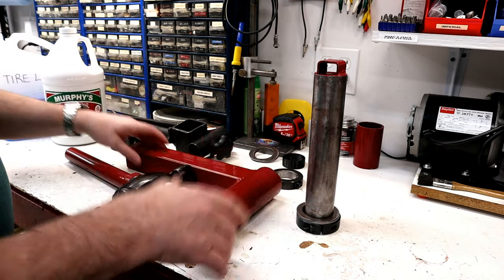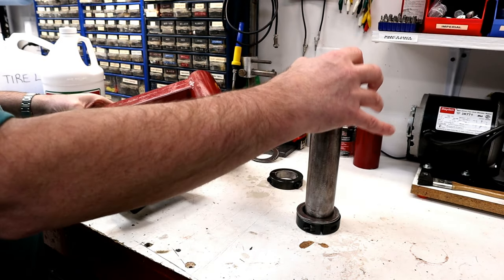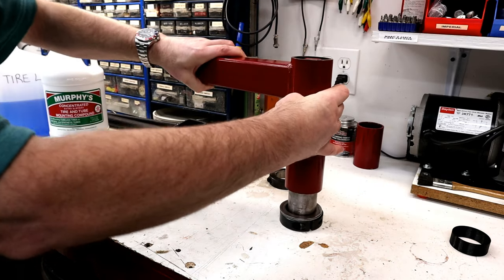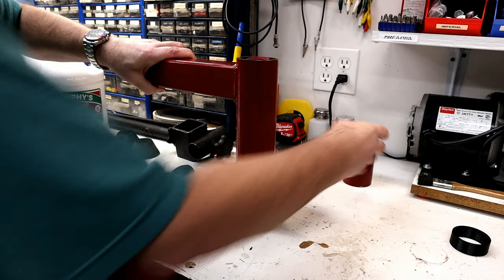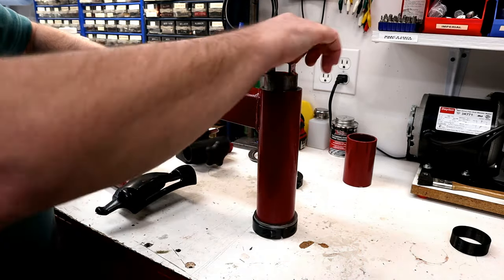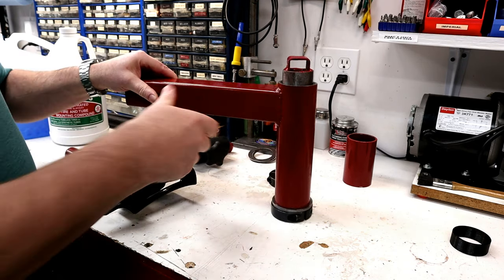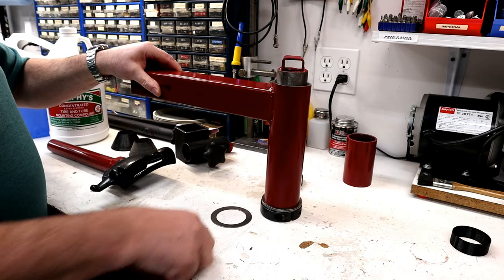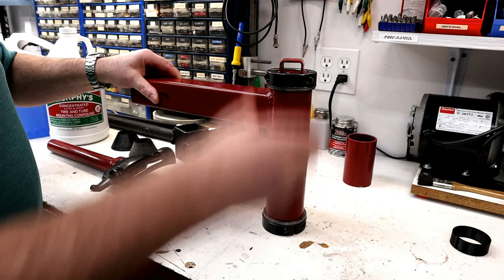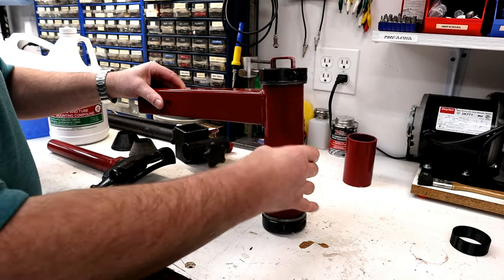All I've done with mine is removed all the paint off so it can rotate freely. I 3D-printed some bushings made on Tinkercad for the right diameter to fit over my tube, then pressed them into the mod tube so now it's a nice snug fit over top. I also had to shorten it to fit over my center tube, and then I've got thrust bearings at the bottom and a shaft collar clamp so it's a nice snug fit. You want your duck bill to ride smoothly in a nice arc around your wheel, then get another thrust ring bearing on top and put on the other collar clamp. Once these are clamped, you just leave it all attached to the center tube and screw this on and off like you normally would on your manual changer.